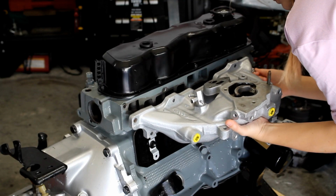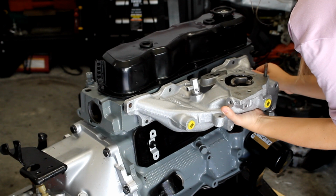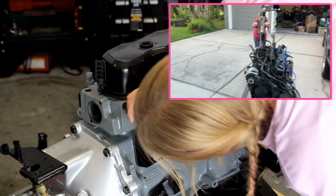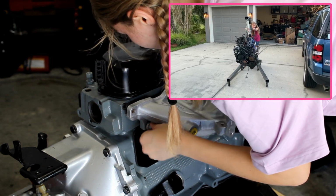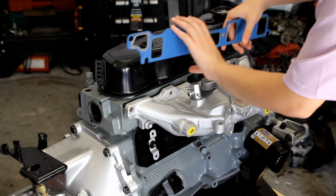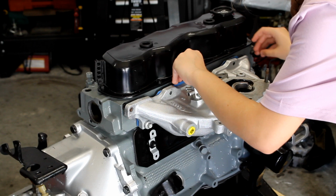With the water port properly coated with compression RTV sealant, I loosely install the intake manifold using only the two bottommost bolts first. If you have an 84 to 86, you might notice these bolts look different. I have a spare 1988 motor that I'm using several parts from, and the hardware was much improved on the 88, so I use the 88's hardware whenever possible. With the two lower manifold bolts loosely installed, the Felpro gasket has the two lower holes notched, which allows me to simply drop the gasket in place.